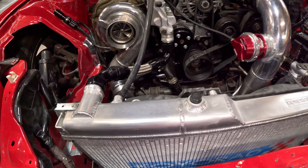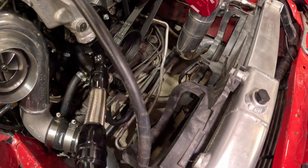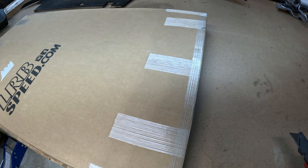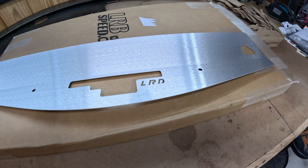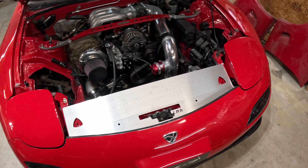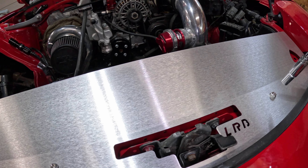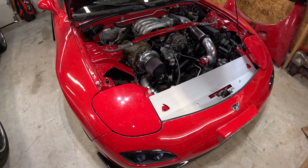I also noticed the other thing that failed was the factory radiator fans. We had only one spinning and that really was not good, so we went ahead and swapped out to the RX-8 retrofit — these work much better. It's a stock housing with RX-8 motor and fans. Let's move on to the parts. The first one we have is from LRB Speed, and this is going to work with the new fans — this is our radiator cooling panel. It's going to go right on top; it's an aesthetic upgrade, but it should help with radiator cooling performance as well. Let's test fit this real quick — and look at that, it's like a glove. I'm going to swap out the hardware for the replacement included in the kit: threaded studs, nylon spacers, wedge nuts to lock it all together, and adhesive padding so we don't scratch the paint. In theory, this should help the air flow through the radiator, not over it. That's done — I think it came out great. I'm probably going to get it powder-coated black, but that's for another video.